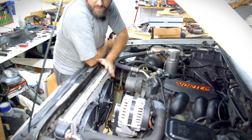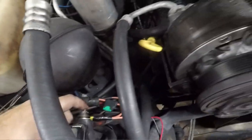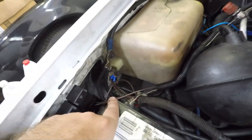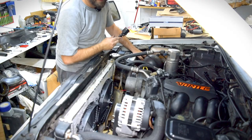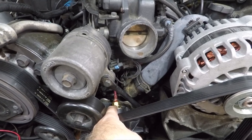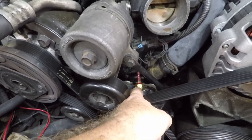The fans are now installed and wired up on the radiator. Both inline fuses for power are connected to the positive battery terminal, and the ground wires are connected to the inner fender. One thing I discovered in testing: my relays were clicking but the fans weren't coming on because the ground connection wasn't solid. After improving that connection, the fans kick on with no problem. I used only one of the temperature switches from the kits, since I spliced the wires together earlier.